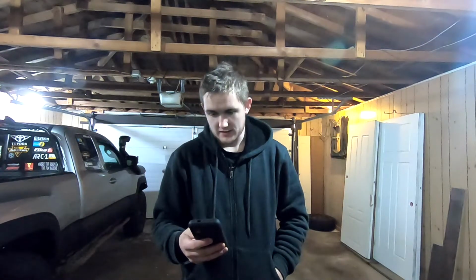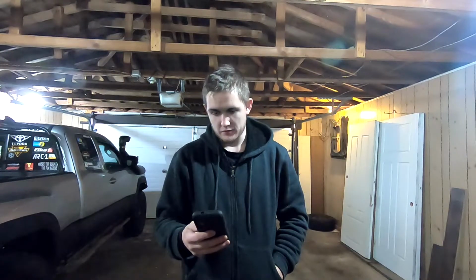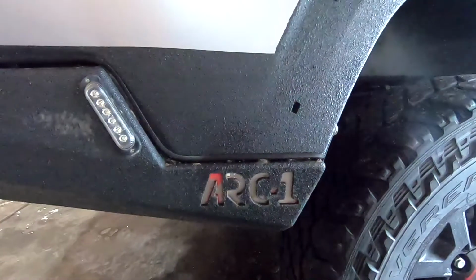You have to seal the entire bumper as best you can. The epoxy primer is non-porous and stops moisture from reaching the substrate. Sometimes where the bumper bolts make contact with the bumper and cut through the top coat can be an issue. So unless that is the total issue, I do not know.